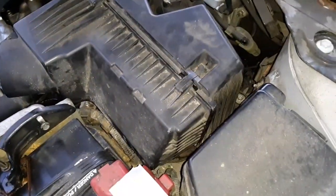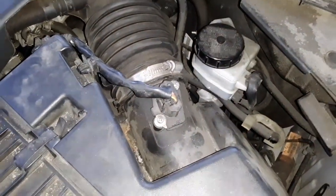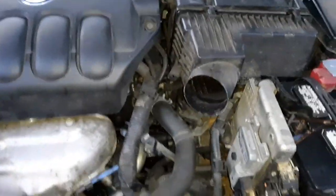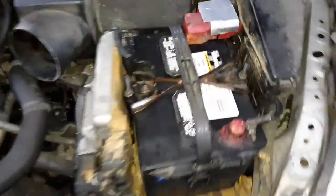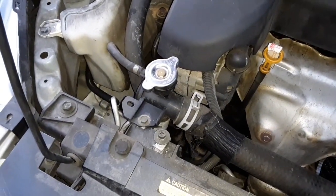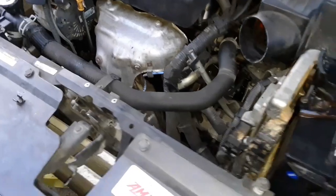You can see that beautiful brand-new air filter in there. Take your time getting everything back. We got the airbox back in — it's kind of funny to wiggle it in. Put your clips back in, reconnect your mass airflow meter, and tighten the clamp on the air tubing. We also need to reinstall the air duct. The battery is all reconnected; I used AMSOIL spray grease on the terminals. We'll be ready to refill the cooling system shortly.